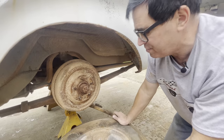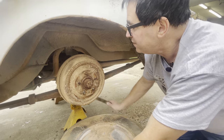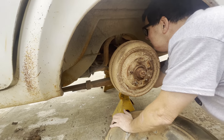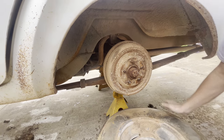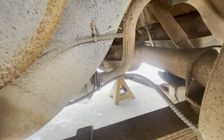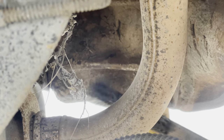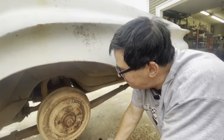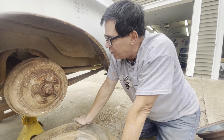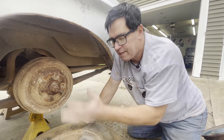The differential — let's learn which case we have. There's a 741 small pinion and a 742 large pinion differential. On the driver's side, let's break out a wire brush and rub this and see. It says 741 — right there, that says 741. So this is the small pinion, which is okay. Probably a 2.94 axle ratio with no Sure Grip. We can't determine the exact ratio without Sure Grip, but it's probably a 2.94. We'll probably put a 3.55 in this thing, but we'll get to that later.